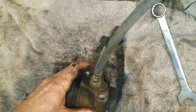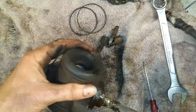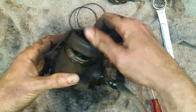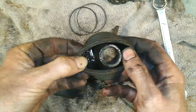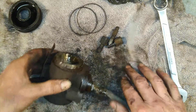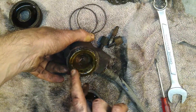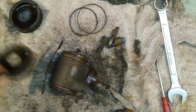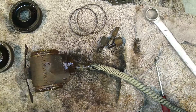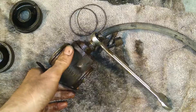We'll pop these clips off. There's a little bit of brake fluid here, so if we peel the covers off — that's been leaking past the cylinder. The little grommets actually keep the fluid in there, so this was on its way out. Both sides are the same. So these brake cylinders — I pulled them out at the right time; they weren't giving me problems but were in need of a rebuild. I'm going to take this hose out; there's a copper washer under there, this is an 18mm fitting, so I'll put it in the vice to twist it out.